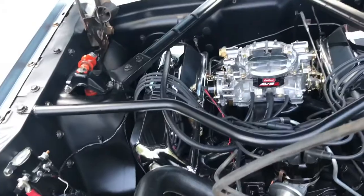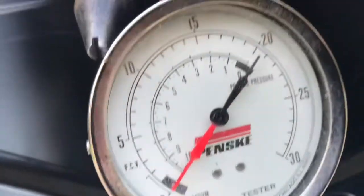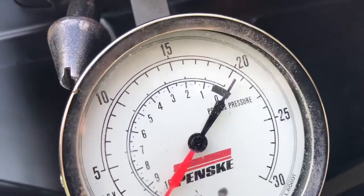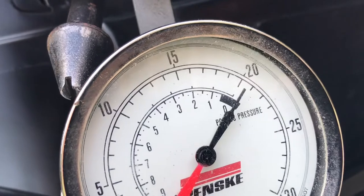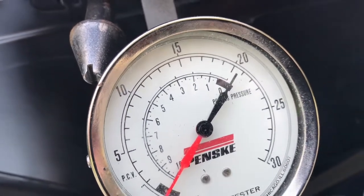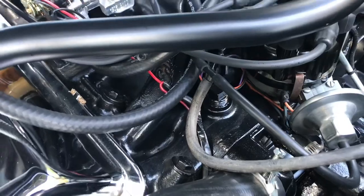You want to be around 20. The red arrow spins around and goes to approximately 20. It can be a little lower — down to 16, though that's pretty low — or up to 22 on the higher side. But you should be right around 20 when you fire this car up, plugged into your manifold vacuum line.